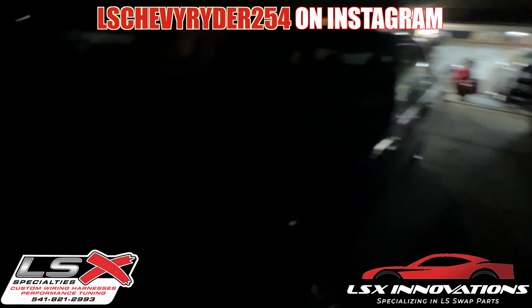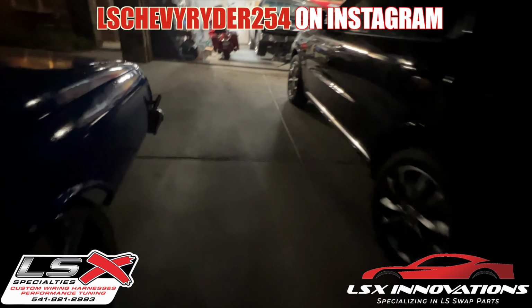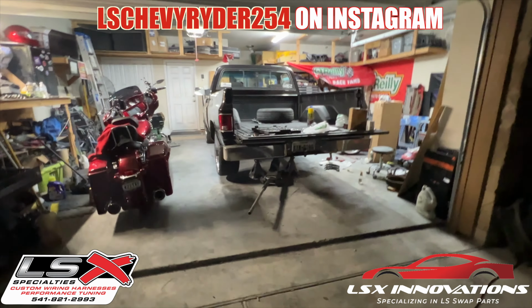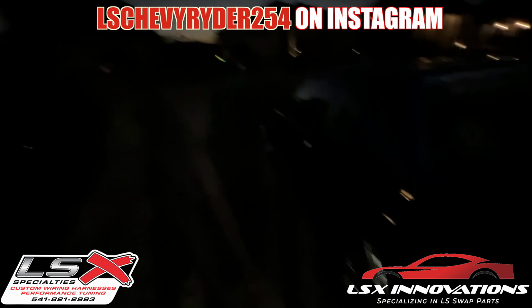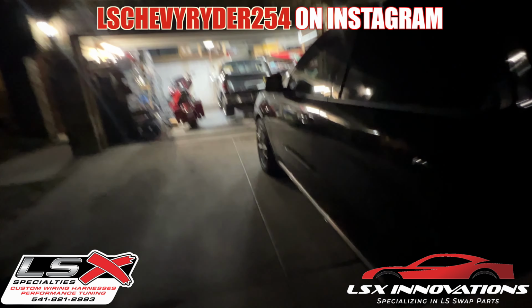But yeah, I put the new master cylinder on there and it seemed to be better. And then I was like, oh, the master cylinder ain't even hooked up. So then when I hook the master cylinder up, it goes all the way to the floor as far as vacuum. So that's the part that's kind of confusing.